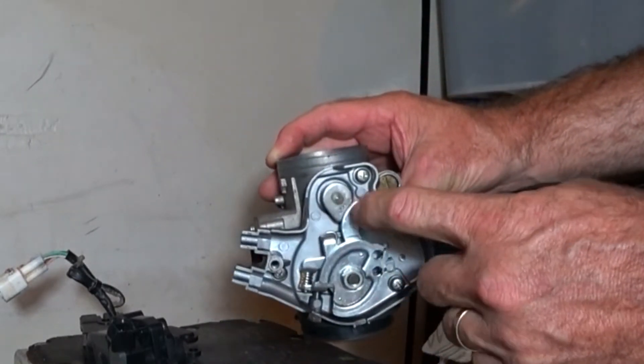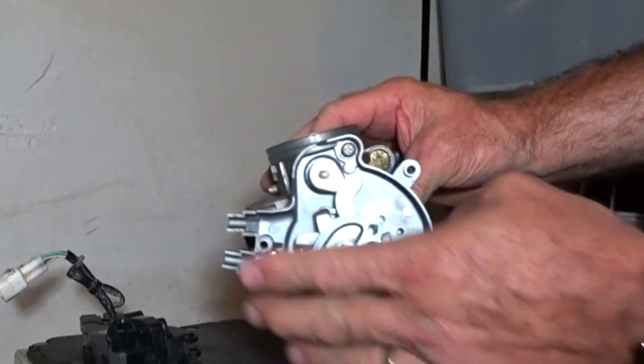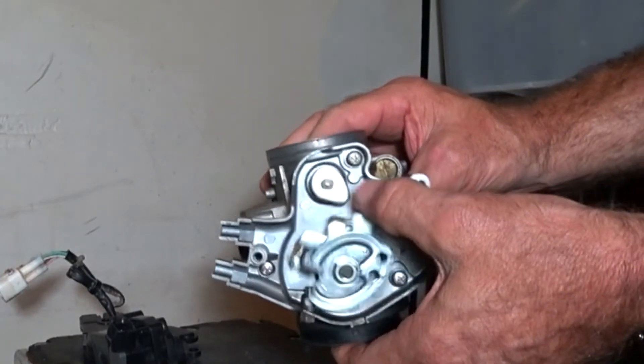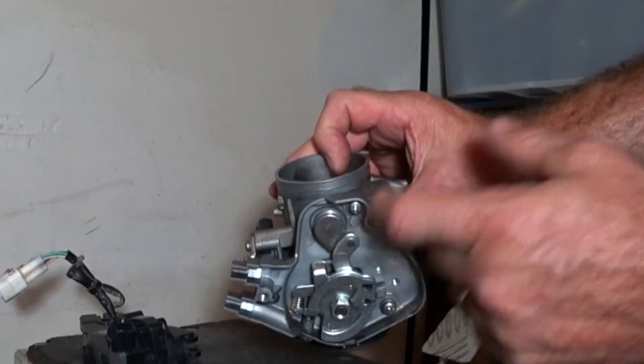That's a hard fix. If you remove this roller then it cannot hang — the idle cannot hang — unless it's a mechanical problem like a stuck throttle; we'll check for that first obviously. Make sure the cable adjustments are right. If this throttle is returning with a nice solid thunk back to idle, then your problem is electronic.